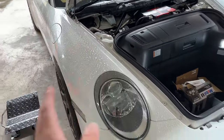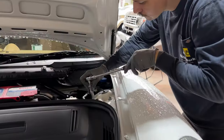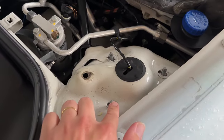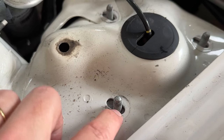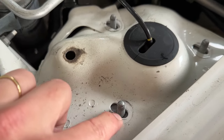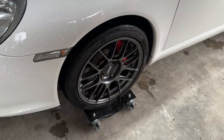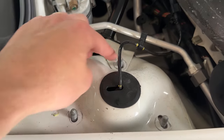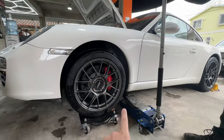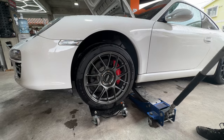Hopefully it doesn't mess with the alignment too bad — it should just be a matter of moving those and putting the car back down. Once you take the bolts off, you can see each bolt to the strut tower has a little bit of room for adjustment. We put it on rollers so that it can wiggle back and forth. This should allow for about one to one and a half degrees of negative camber stock. Now he's taking weight off the car so he can wiggle the wheel.